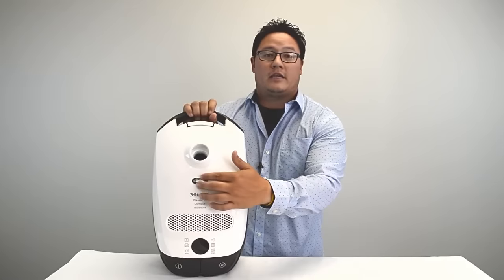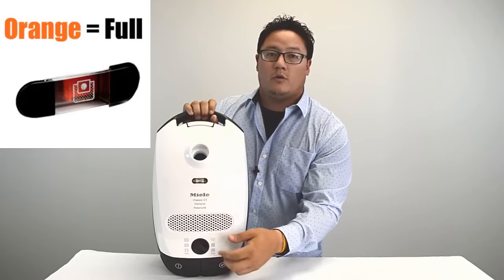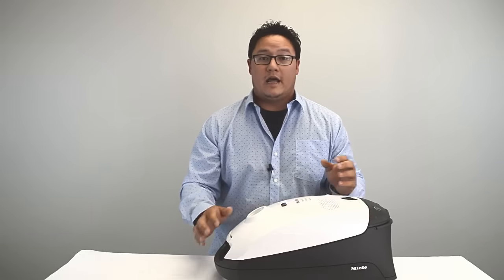Vacuum bag maintenance — rule one is don't overfill the vacuum bag. It's amazing how many people make this mistake. The Miele comes with an indicator bar, and as your bag gets too full it's going to turn orange. This happens gradually as the machine calculates the airflow coming through — it can tell how full, how stressed the vacuum bag is. If it's too full, you'll lose performance and it's going to stress out the motor. Anytime your vacuum can't pull air in freely, the motor gets hot, overheats, and could cause long term damage.